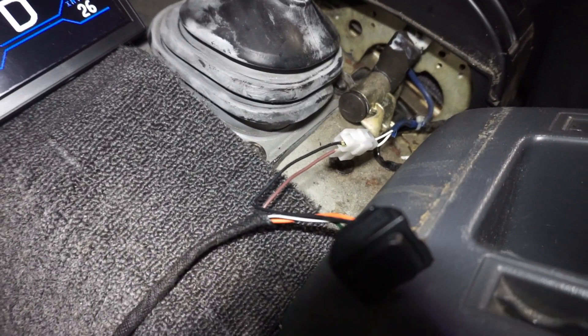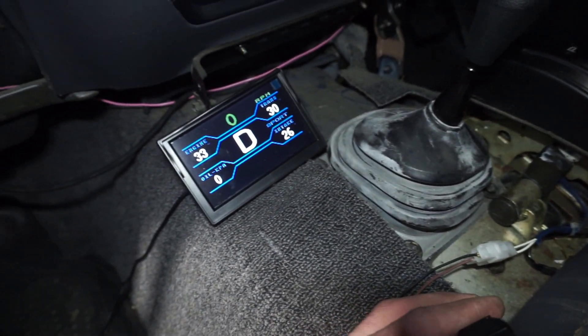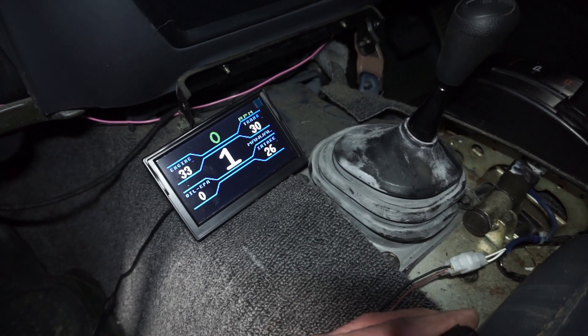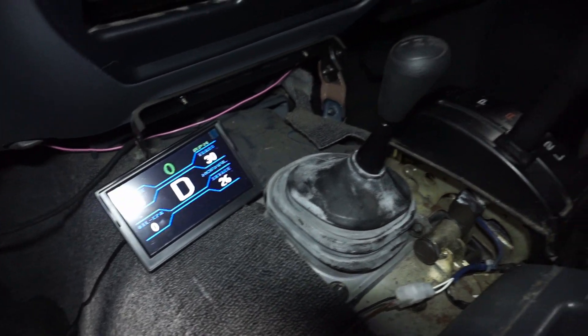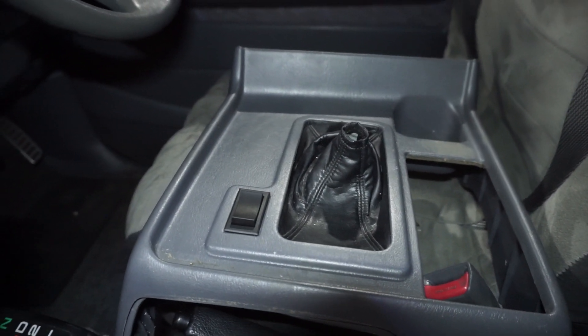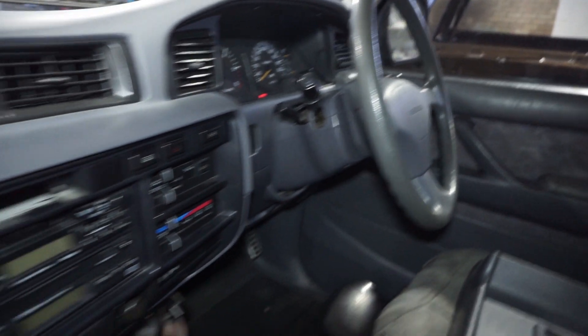I'll be using another one of these modules supplied by Allen that we use for most of the auto conversions. These come with a little LCD screen displaying what gear you're in along with RPM, coolant temp, oil pressure, and trans and intake temps. I've got the old overdrive button wired up to switch between sports and normal mode. Down here is the switch for tap-up tap-down — once in sports mode you can click up or down to enable manual shift. I found a switch that fits in the console, so we'll get that fitted and then take the dash out to do the tacho mod.